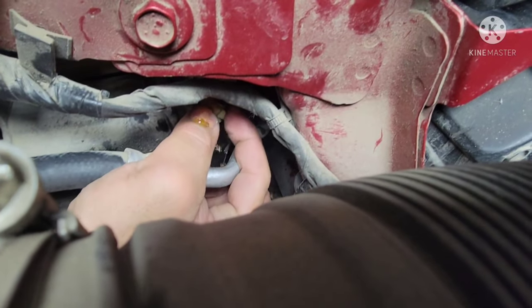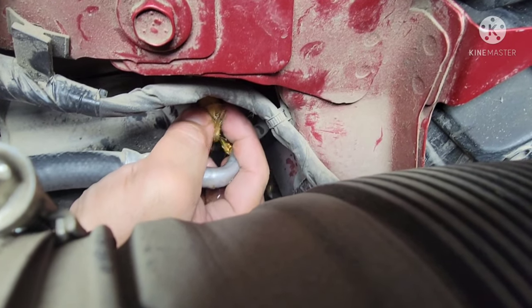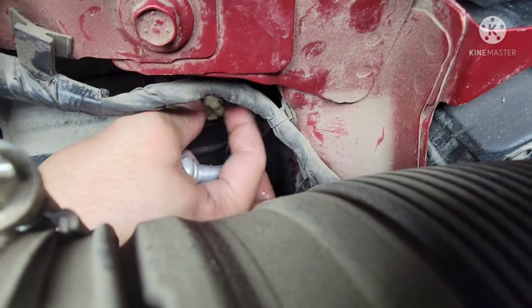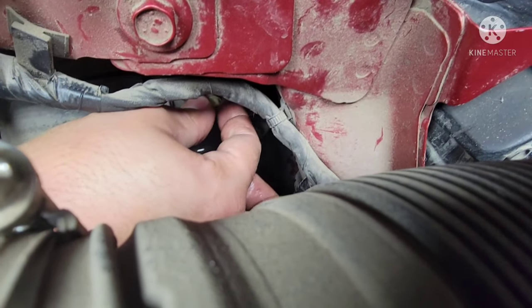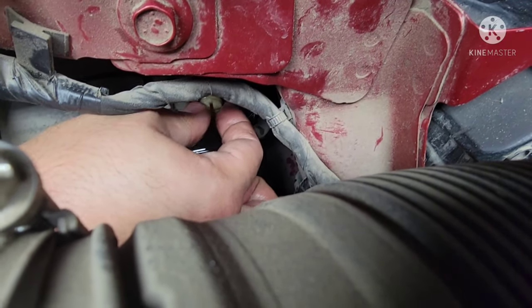Back in and draining coolant here — it looks clean, no bubbles. We're just gonna tighten her up and then go for a drive. We're gonna use our scan tool to monitor the coolant temperature in Fahrenheit while we're driving and keep an eye on the gauge.